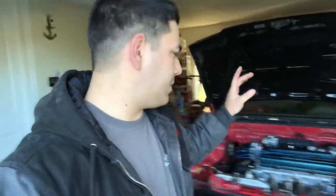All right, so the vehicle speed sensor is back in, the oil filter is tight, the engine is primed with the oil. If you don't really know how to do that, I explained it in the second to last video, when we did the first startup for the CRX, I went in depth on doing that. Transmission oil is full, engine oil is full, everything is ready to start up right now. That does pretty much sum up the video.